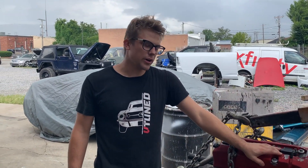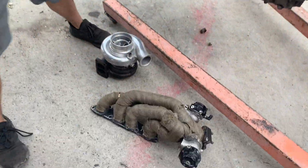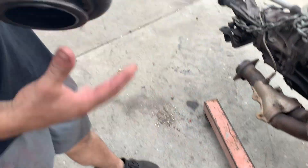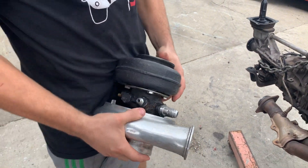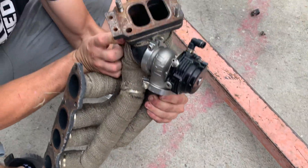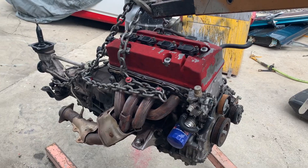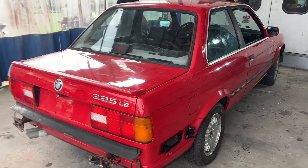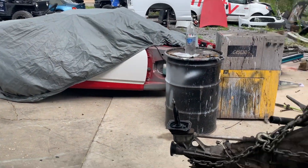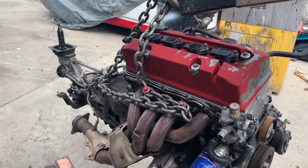What we got here is a 2003 Honda S2000 motor — it's an F20C. It's got quite a bit of miles but that's not gonna matter because we are gonna rebuild it. On the floor we have some force induction components: an exhaust manifold, a full HX40 twin scroll turbo — this is a very good setup for four-cylinder motors — and dual 38 millimeter wastegates to accommodate for some good PSI. This thing's gonna make some noise. We also wanted to go with the four-cylinder because I plan on putting all the M3 body parts on here, and I wanted to stay with the four-cylinder since the E30 M3 does have a four-cylinder. Plus we had this whole swap out of that car so I figured might as well take the opportunity.